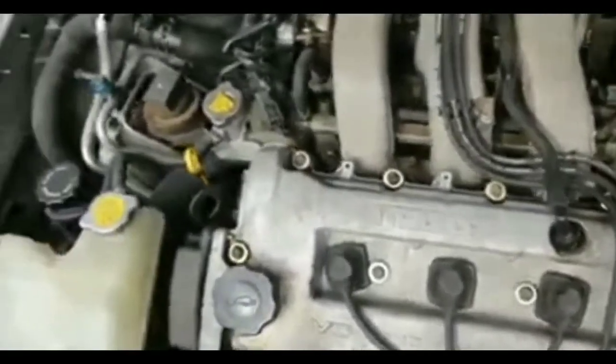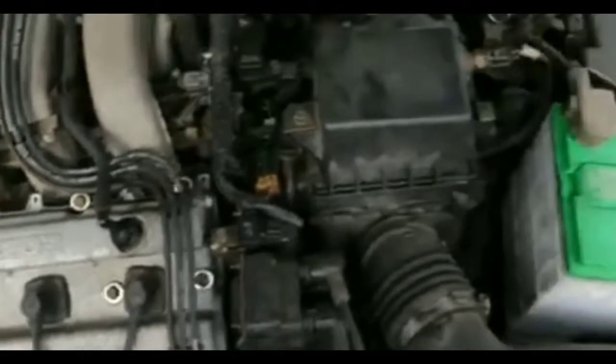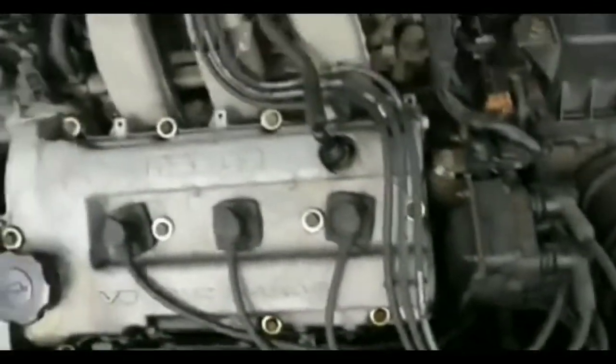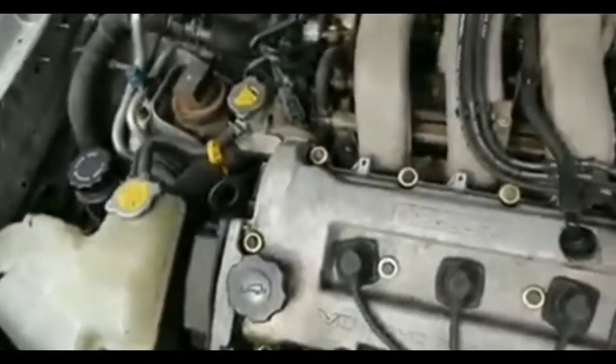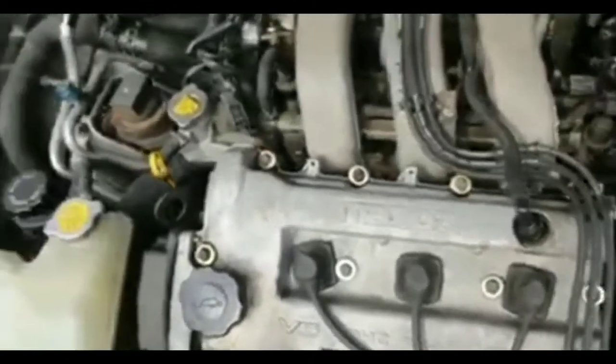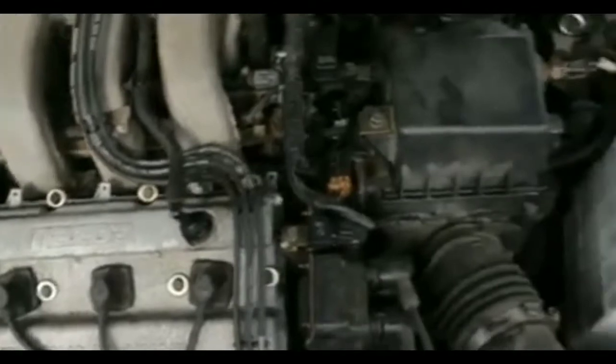So I'm like, okay, this is probably going to be a bigger issue now, because next up, I got to check out the electronics of this car. All right, could be a fuse, a relay. So right off the bat, I'm thinking maybe the relay. I took the cover off the fuse box and checked to see where the starter relay is. I'm like, all right, found it.